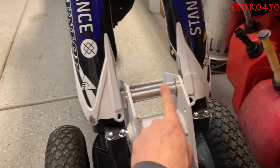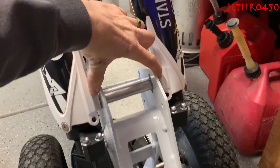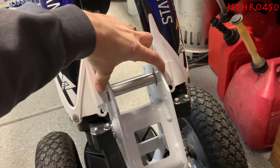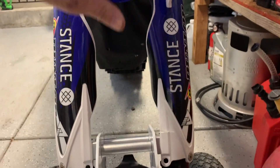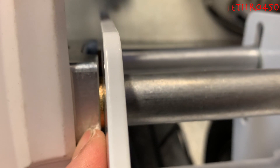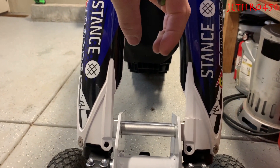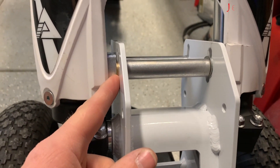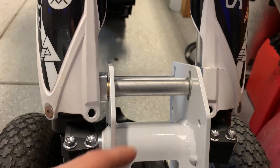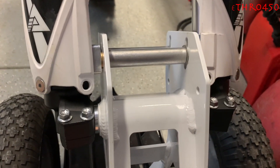Speaking of the spindle — in talking with Brad at Timber Sled, you actually shouldn't have the brace where it is stock; you should move it to the other holes. The reason is you want the front clamp bolts to provide the most clamping force on your spindle. Something I noticed when I put my spindle together: when the forks are sitting there with nothing bolted up, there's actually a tiny bit of space between my spindle and the right clamp. If I had simply tightened everything up with that space there, I would have pinched my forks. You don't want to pinch your forks. Because I had to put a washer in there, I feel like I'm already losing clamping force.